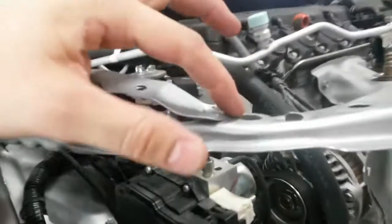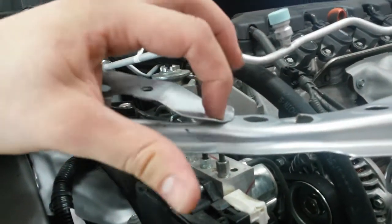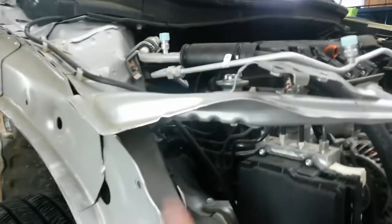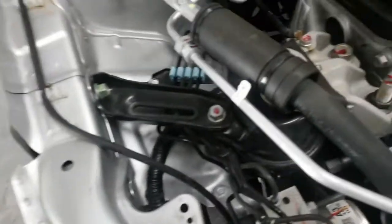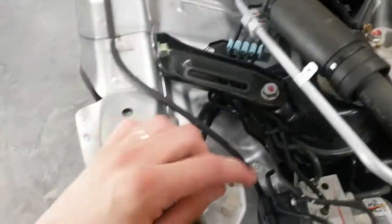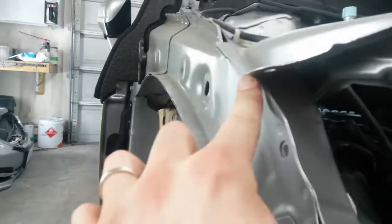I got the little buckle out of this hole. This hole was buckled up right here and a little bit underneath this weld. I just tapped that down, straightened this thing up a little bit. I was thinking this kink was put in it, but that looks like it was made that way. The paint's not broken or anything. And there's a mount back here for the washer filler neck. This goes down inside there, it mounts. So those two holes. But it appears that this was made this way. It's too smooth and it's not pulled away here at all. It would have been pulled away from that weld a little bit.